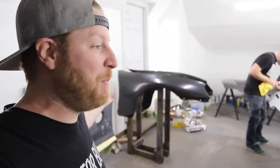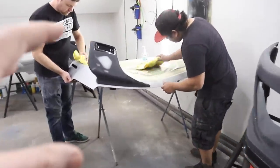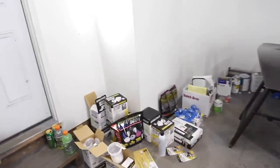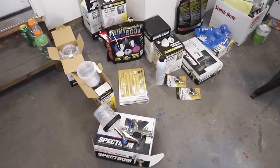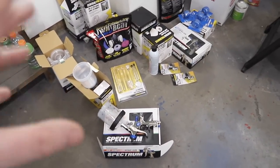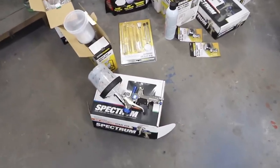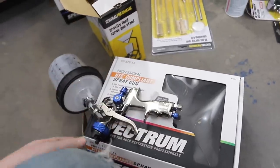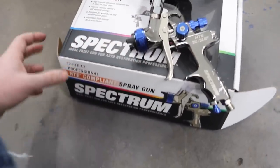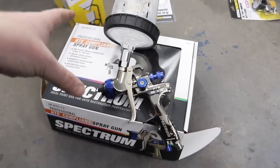This place looks a little familiar — we're back in the OG paint booth. We've got all the parts in here. We're going to paint up most of these parts that are black, so they'll go primer, base coat, clear coat before we do the car. Everything is set up and ready, and we're just finishing cleaning work on the rear hatch. I want to talk about our new spray system. Harbor Freight, our great friends at Harbor Freight, sent us basically a new painting setup. We're going to try painting with compressed air once again. They've got some really new fun guns that I wanted to try out. This one is an HTE gun — it's different than the HVLP — and that's the 1.3mm tip.